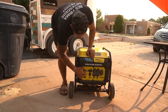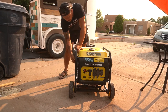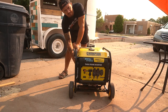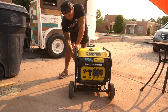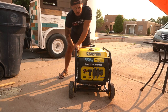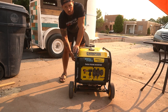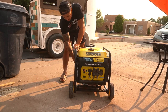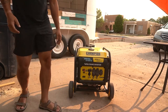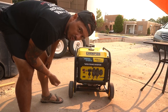So let's get this thing started. It's on — I'm going to turn the eco mode off for right now and pull my choke out. Get it nice and tight before I pull; you don't want to see that wiggle — you don't want to yank on it because you'll end up popping your cord over time. You want to pull the tension tight first, then pull and try to get your legs into it. That's the choke — I push it in and it'll run a little bit more smoothly.